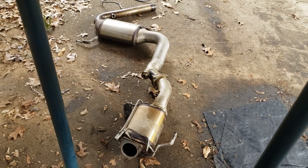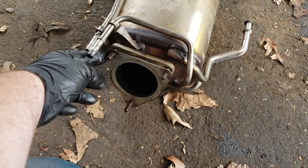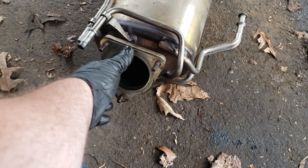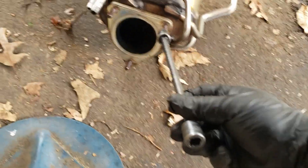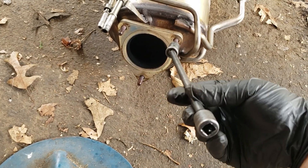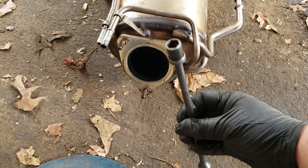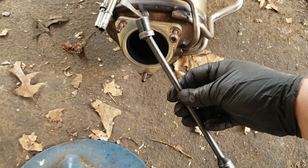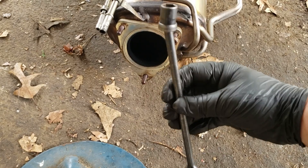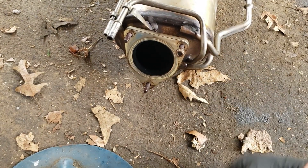The DPF is out along with the SCR — came out pretty straightforward and easy. The DPF is this big tank right here. Normally we end up breaking the studs, but this one came loose really easily. The socket I was using to get on that nut is a long wobble — I was turning it from the side through the suspension to get a good angle on it. This is an old Snap-on long specialty tool, actually for Toyota and Lexus transmission oil pan bolts — now sold as a power takeoff socket. It's just a 12 millimeter six-point long wobble on a stick. That's how I get at that and make life drastically easier; most people end up just cutting these or breaking them.